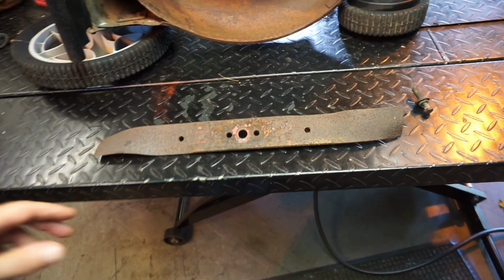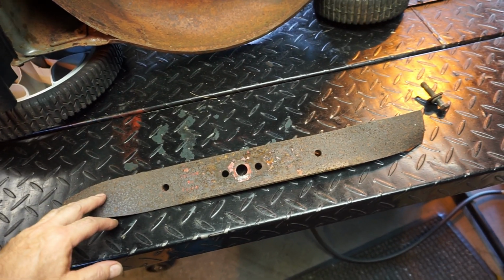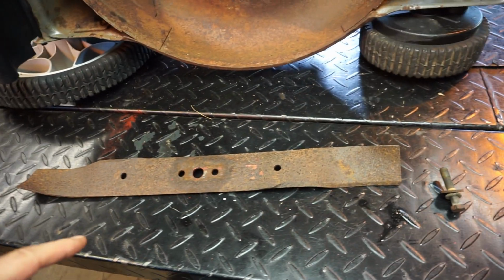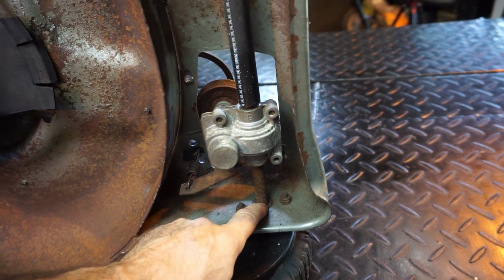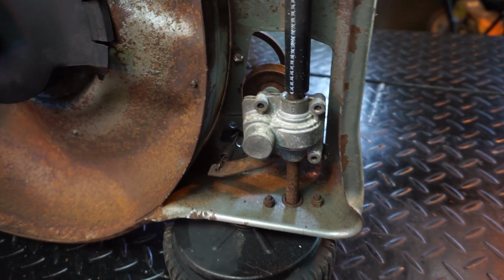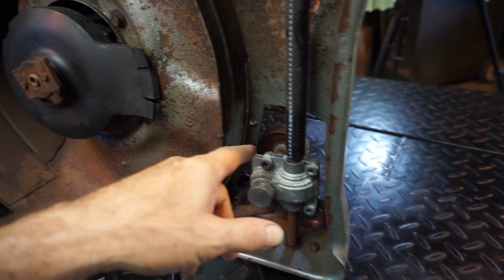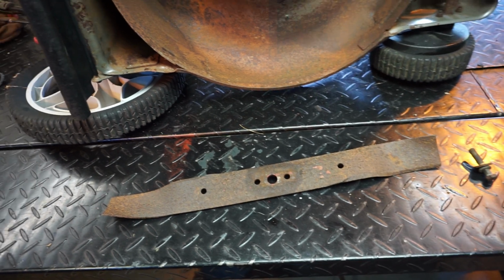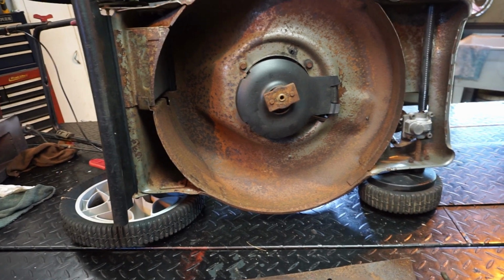All right, fellas, now before I go any further, we need a blade. We need to solve some of the issues up here. So a couple things we're going to do. We're going to clean up this blade. This is one I pulled aside and I checked it, and it's okay. It's just filthy, so we're going to grind that up and sharpen it. Then we want to clean off this surface. I'm going to put the belt on. We'll come over here. I'm going to put some oil in all of these spots, flip it over the other way, get all this cool transmission. Look at this little thing. So we're going to get some lubricant and all of that, and we'll wire wheel. I'll show you a little bit later. We'll wire wheel that pulley a little, get things unstuck, and I'll put a little paint on this blade because customers just like that. So when I come back, we'll do all of that, and I'll show you what I have, and we'll get that squared away.